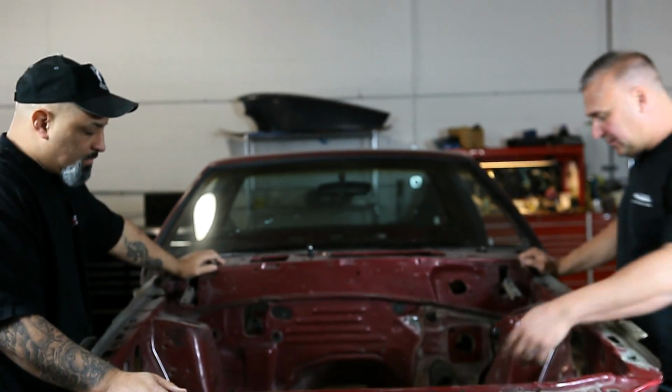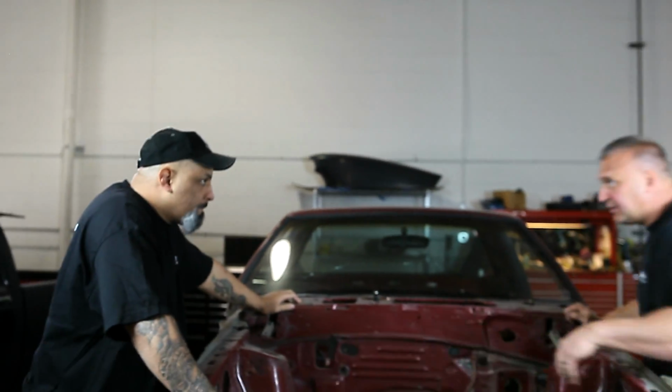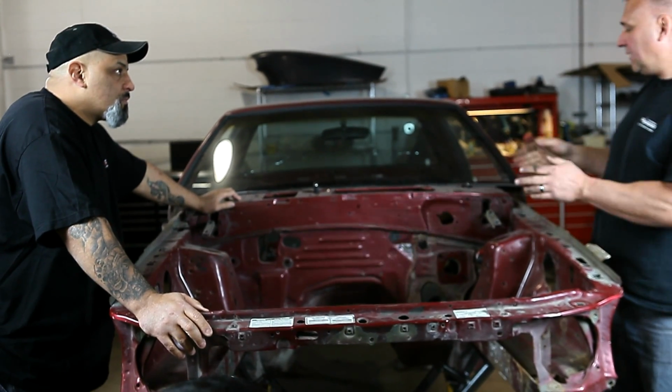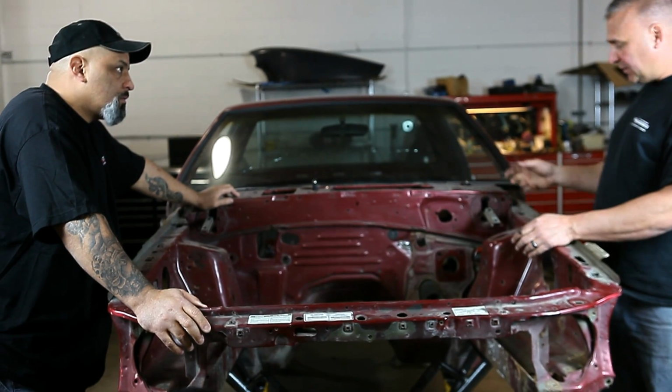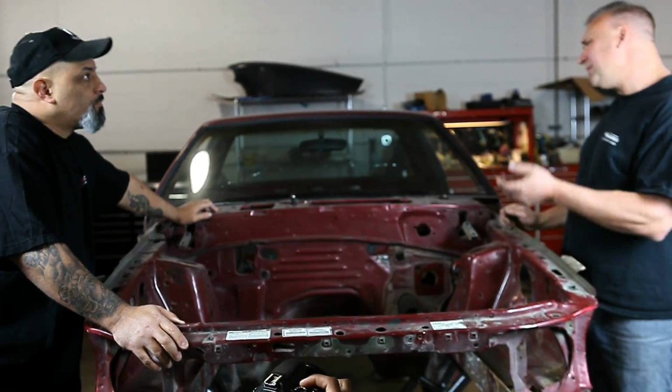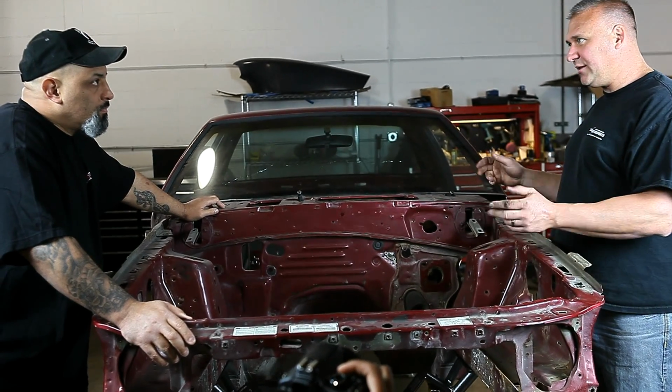Slides and on that, and you adjust the steering shaft to fit. Normally the steering shaft can slide in and out of the column a little bit. We do drop the rack a little bit. You have to pull the shaft out of the column, maybe 3/4 of an inch. Everything will line back up.